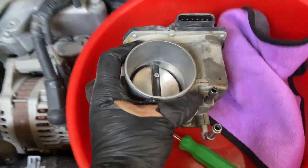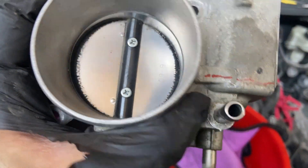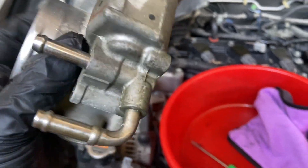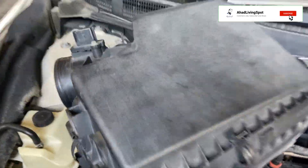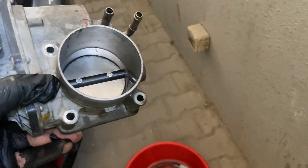You can now clearly see how much carbon is stuck to the throttle body valve. I use this Manol brand product to clean the throttle body valve and will give the link in the description. Similarly, to clean the mass airflow sensor, I have used a product from the brand Liqui-Moly. Spray it well five times on the throttle body and let it soak for five minutes. After that, take a clean soft cotton towel and dry it clean like this.